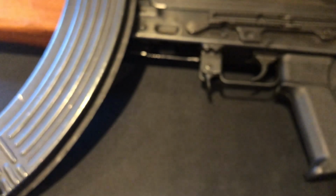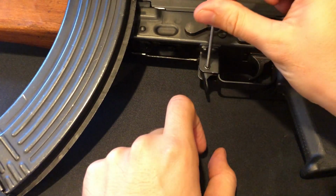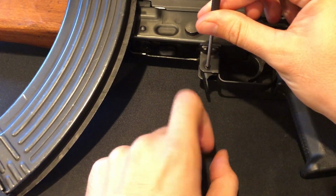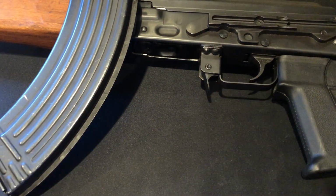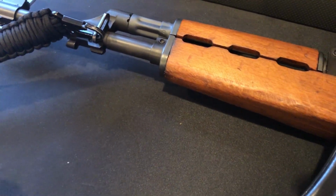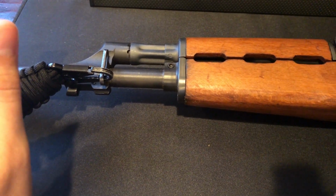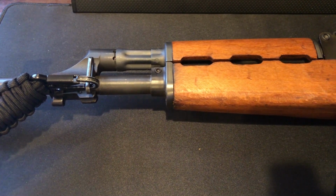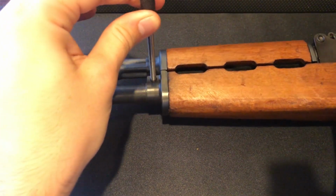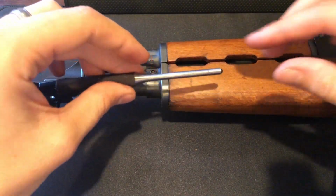So I'll show you exactly where you would put it. In a transmission, you'll find these as well, as mentioned before. But you see there's a little divot right in there, and this is exactly where this would fit. It fits very nicely, and it'll keep it centered, so when you hammer on the top, you can get that pin out. Another place you would find it, we'll move the camera. There you go, near the front. Here's another one. This one looks bigger than the 1/8, maybe it's a 3/16. We'll pull the 3/16 out, and there it goes. Fits perfectly in there. So this is definitely a nice little cool accessory.